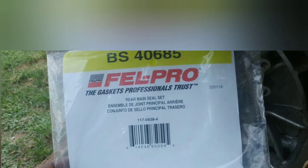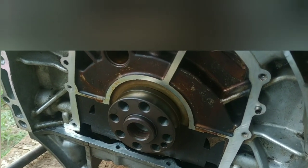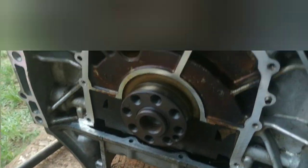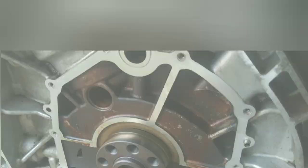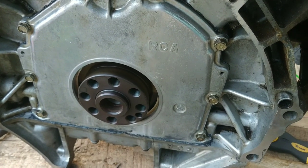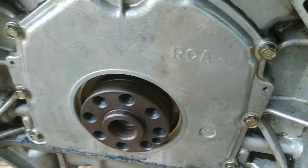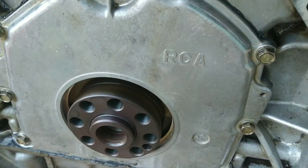Here's the gasket I'm making use of — it's a FelPro high quality rear main seal set for this 2003 Accord. It comes with the rear main seal itself and the o-ring that will be going on right here. Next I'm going to apply some RTV silicone to the cover, place on the o-ring, and then reassembly begins. With the cover set back in place, I'm now going to wait about an hour before torquing down the bolts around the cover outside and the two below to the recommended torque spec.